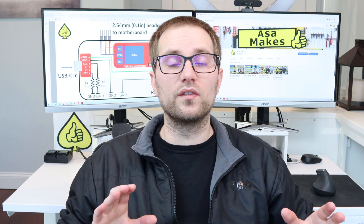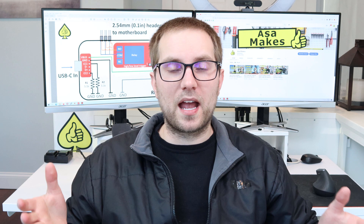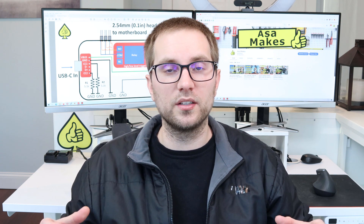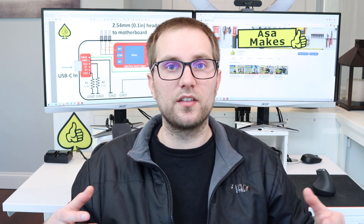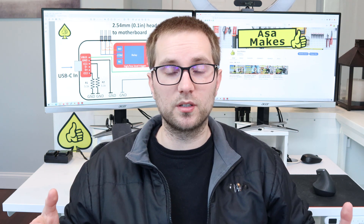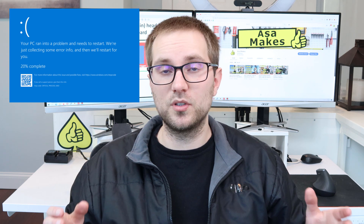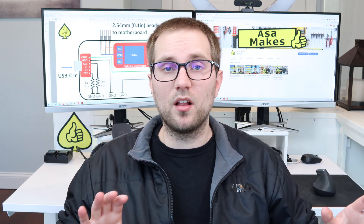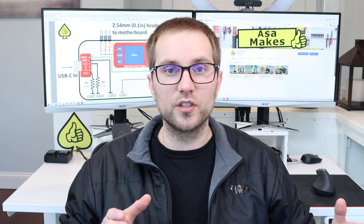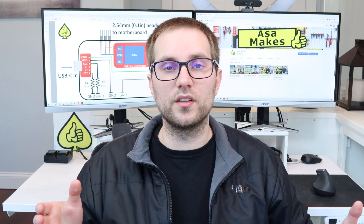There's power-on over LAN, which allows you to turn on your computer remotely using an ethernet cable, but these have some drawbacks. First, I want the power switch or the reset switch on my computer case itself to still work. Second, I want something more robust than power-on over ethernet. Sometimes you just need a hard reset, which may not be available or correctly configured with Wake-on-LAN. You may also have issues using a static IP with your internet service provider — there are a number of reasons why this could be problematic.